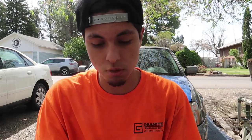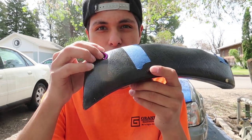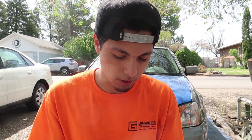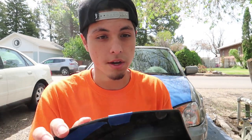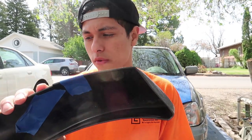I'm going to start with taking the beauty washers and laying them up more or less where I want them to sit and drill the hole out. They seem like they're a little big, but this should be fine. They should line up. I'm going to get in there with probably a center punch and then punch it out so I can start drilling. I'm going to drill these out first so then when I put them on the car, I already have the hole here and I don't have to mess with putting the hole on the car and this thing at the same time.